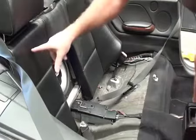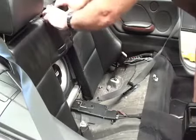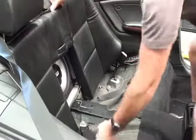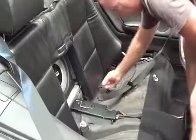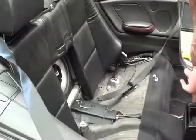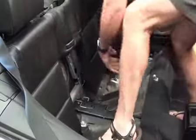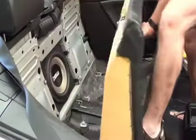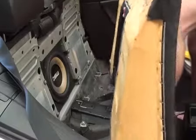The actual seat itself just has a clip in there and a big clip in there that just pulls up. You need to get out of the way of this first. And whilst we're doing that, there are two 10mm nuts down here which you'll need to remove. Pull those clear as well as pull up at the same time and that's going to pull it out. That will just pop out. The clips look like that and they just clip over there — so that's what you're pulling it clear off.